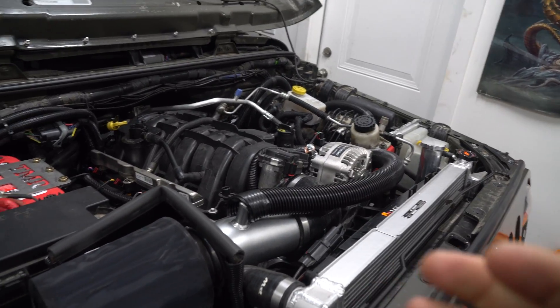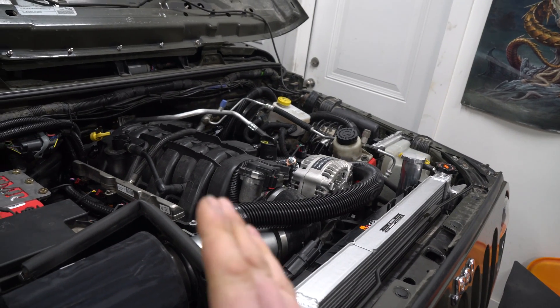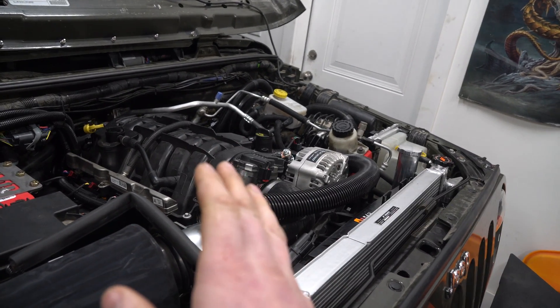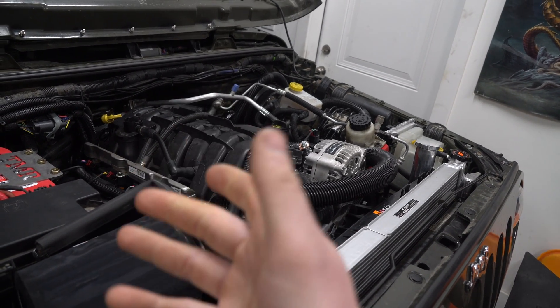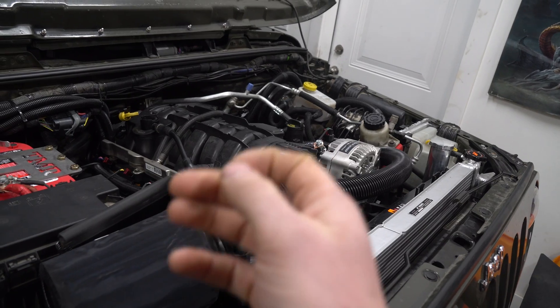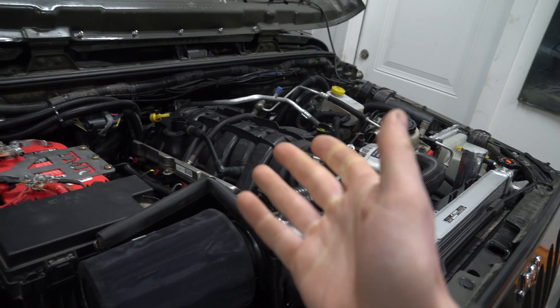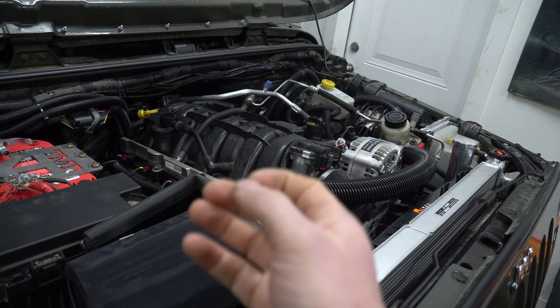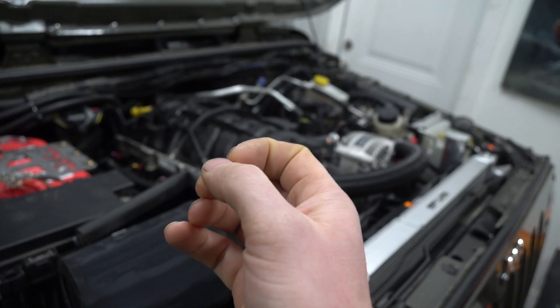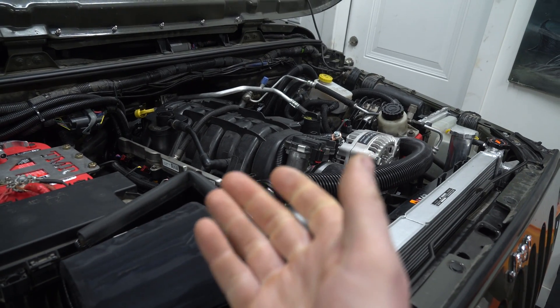It was really short because we still have to adapt the security key. The biggest thing is you need to go to a Dodge dealer — if they'll give it to you — or another place, and you have to acquire your VIN key so that way you can adapt this through the Alpha software. We're going to show you a little bit how to use the Alpha software, but the hardest part you're going to find is getting that key. Once you have your key, it's really not too bad to adapt the ECU.